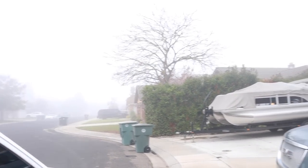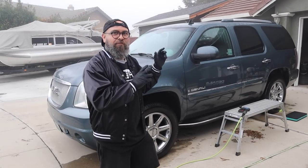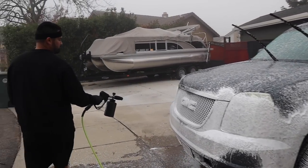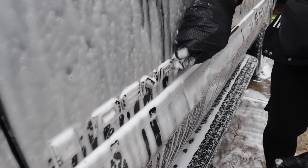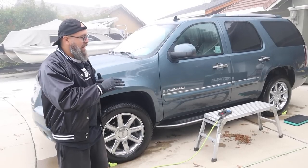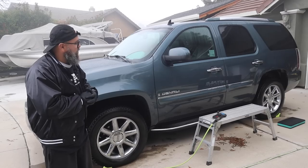It's foggy right now — how does that affect things? The fog means quite a bit of precipitation in the air. What we generally do is we don't do any finishing touches till the very end. It's actually a great time to clay, because we use the soap method — spray the whole car down, wash it, rinse it, then foam it up again. That soap acts as our clay lubricant. With no direct sunlight, we have plenty of time for the soap to dwell as we clay all surfaces. Then we rinse, polish, put some Bead Maker on to seal it, and start on the interior.